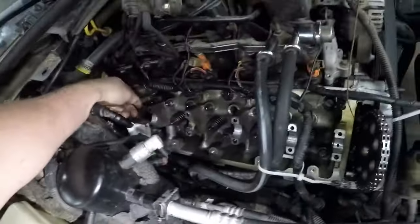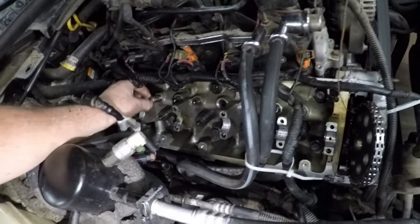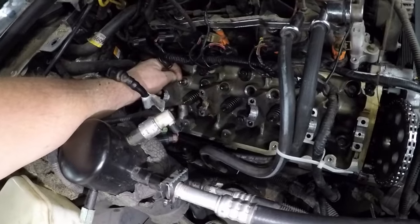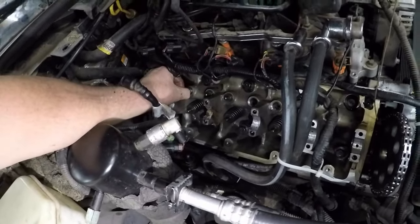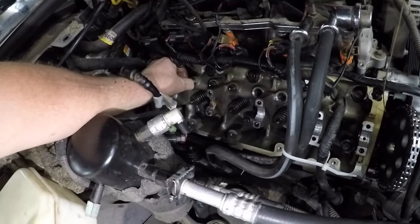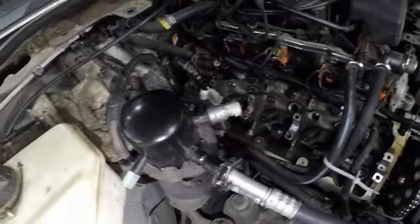And so I pulled these lifters out and got them back up, because they were completely collapsed as well. This inner was completely down. So I thought, okay, that's what the problem was. The lifters have collapsed, and you can kind of rebuild them. You just got to crimp that ring back on there.